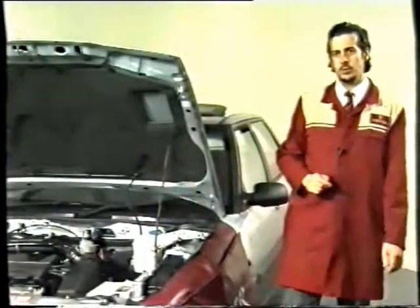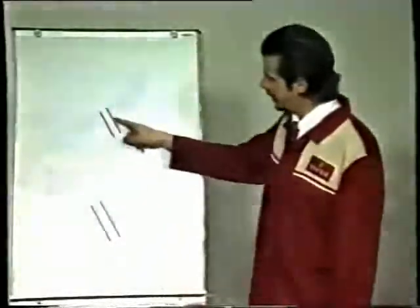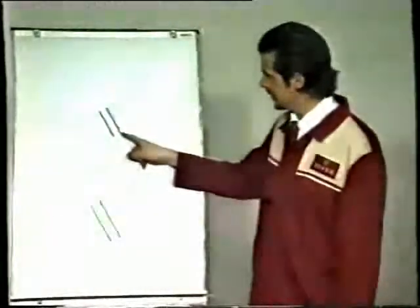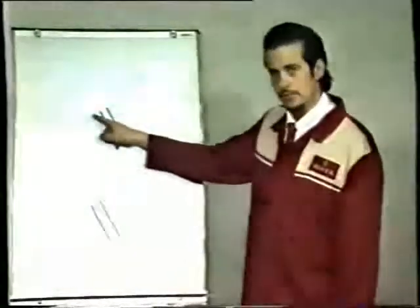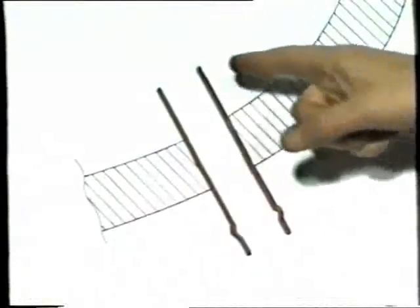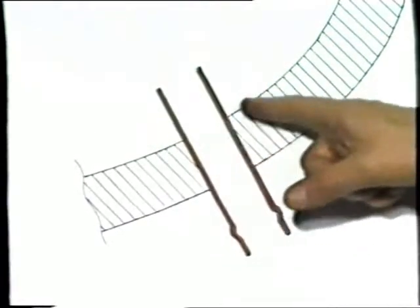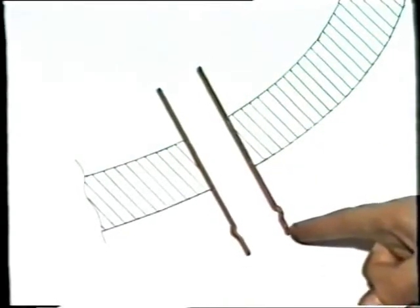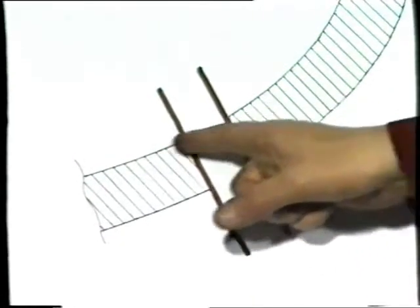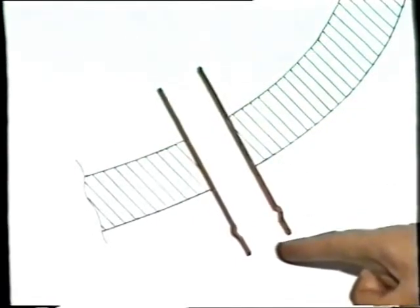I'll use a flip chart to show you what we're trying to achieve. What happens is that oil lying in the bottom of the inlet manifold runs down the stub pipe and into the ECU. This is due mainly to the fact that the inner end of the stub pipe lies flush with the bottom of the inlet manifold. If we increase the length of the stub pipe and raise the inner end so that it stands proud of the bottom of the inlet manifold, while still keeping the same amount protruding on the outside, any oil lying in the bottom of the manifold won't be able to flow down the stub pipe and into the ECU.